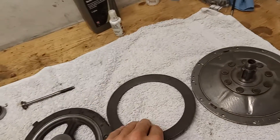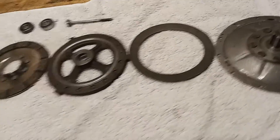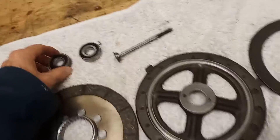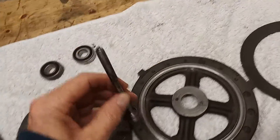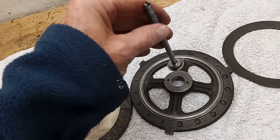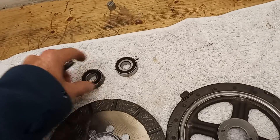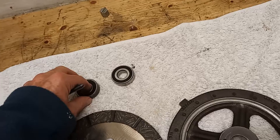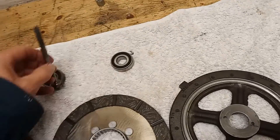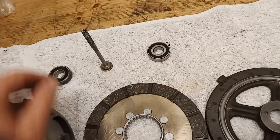Other unusual things: unlike a multi-plate clutch, you can't adjust the tension of the spring. On a normal multi-plate you can screw the springs tighter or looser, but you can't do that on a Trident. Also, because the clutch is pulled open, the bearing sits in the cover plate and the pull rod goes inside the bearing and actually pulls the clutch open via the main bearing. The problem is the bearing is designed to take radial forces, but the pull rod is pulling the bearing sideways to open the clutch.